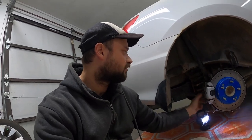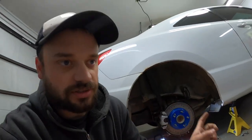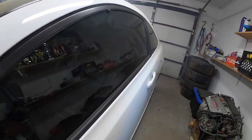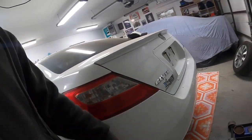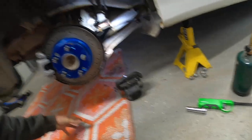While I got this wheel off I remembered I still have to fix the e-brake spring, but it's cold outside and I have to pull it off the red car. Let's do the exhaust. The old muffler is gone but the flange is still there - I gotta try and get those bolts out. The muffler I bought still has its flange from the B-pipe on it, so I have to get those bolts out as well. Then we'll see if the gasket I bought works. I used some heat and got them off without breaking them. I gotta get the rest of that gasket out of there, and then we can work on the muffler.